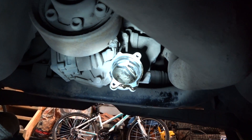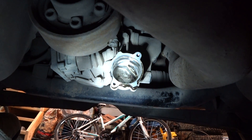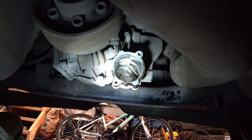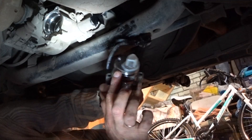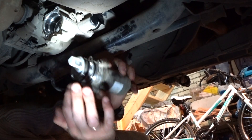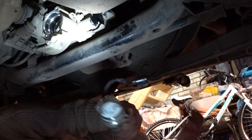Where the pump sits, clean it with a rag. Notice the oil is still kind of dripping, so let it drip a little bit more. Before reinstalling the pump, make sure to lubricate the o-rings using the same oil that you're going to be filling the Haldex with.